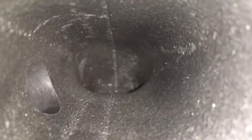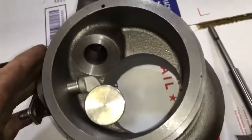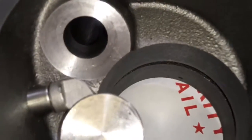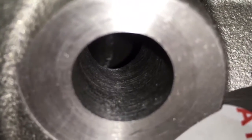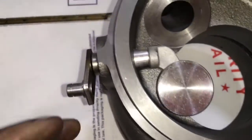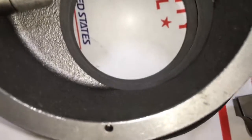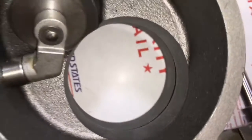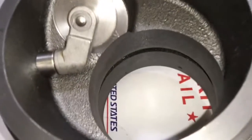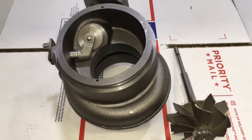We recommend using this turbine wheel and turbine housing upgrade even if you just have a regular HE 351. The reason is because the HE 351 already has an HX 40 compressor wheel, which is 60x86 millimeter. The HE 341 had two different versions — one with a 56x78mm wheel and another with a 54x78mm wheel, the same as the HX 35 — but I prefer to use the HX 40 compressor wheel at minimum, which is the 60x86, the same as in the HE 351 CW.